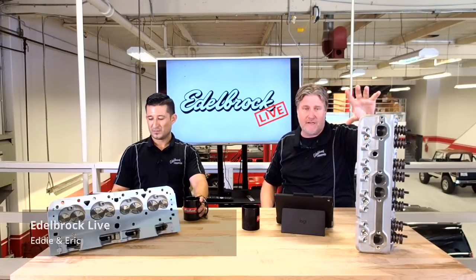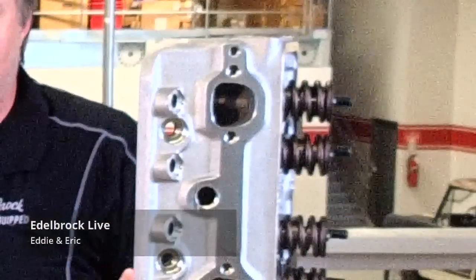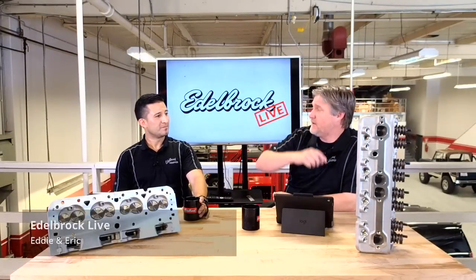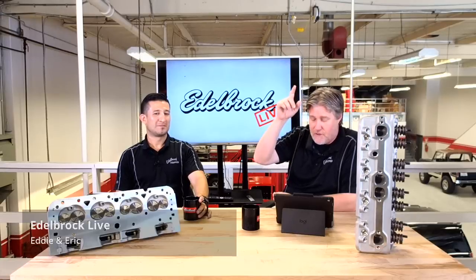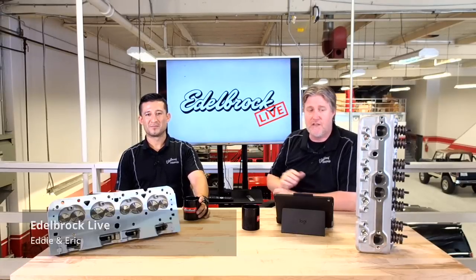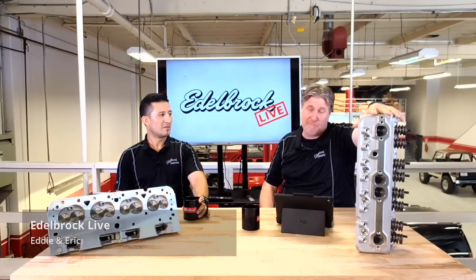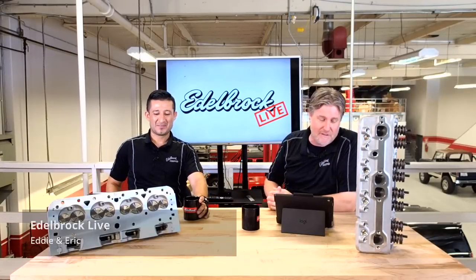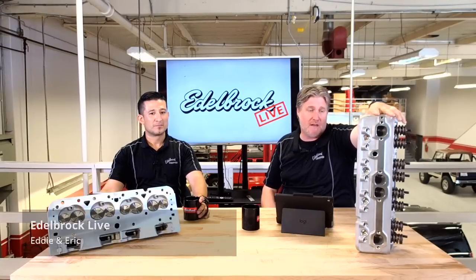It's got the Helicoils, it's got the threaded rocker studs. Just like every other cylinder head in our line, it's designed by the guys here. It's cast 90 miles east of here in San Jacinto at our casting facility, and then it's trucked back here. Behind the camera in our production facility in back, it's machined — all the final machining and assembly goes on. So it's made in the USA — actually made in California. It starts as an idea here and goes all the way through. It's A356 aluminum, heat treated in our facility out in Hemet. It's a high quality product, just like all of our other heads.